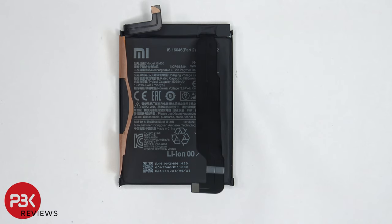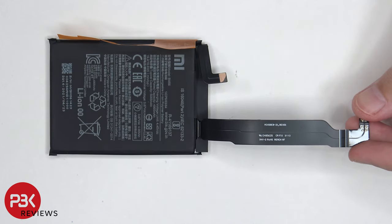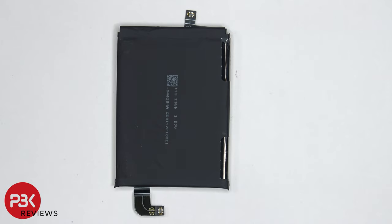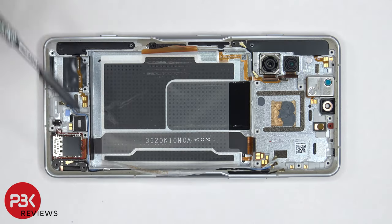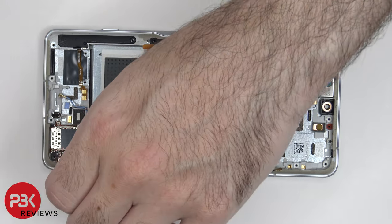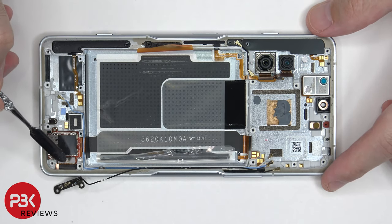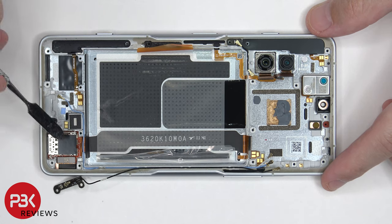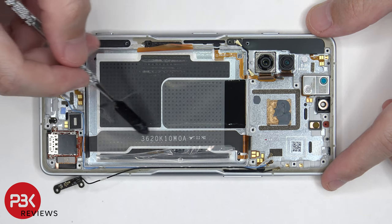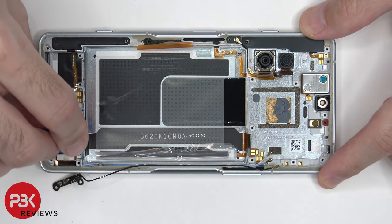Here's a better look at the battery and here's the other side. There's a black coaxial cable connected to an antenna assembly on the corner which we can lift up and remove. Once that's lifted up, we can see the screen cable connected to a flex cable that also has the SIM reader and runs along underneath the battery and connects to the main board. The connector for the screen can be disconnected by just popping it off.